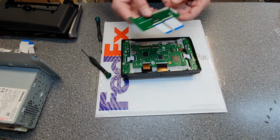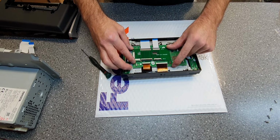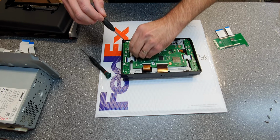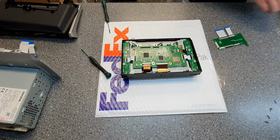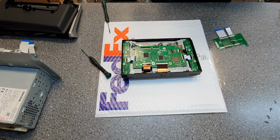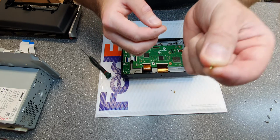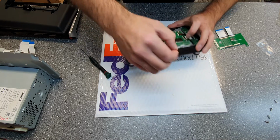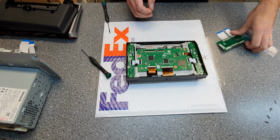Now we're going to install the video board. You can see the 2 screws here. It's going to be like that. Unscrew these 2 screws. These you don't need anymore. And you got 1 plastic bag with 2 new screws, 2 extenders. Take these extenders and screw them in the same holes as the other screws were. And also have something underneath so you don't scratch the screen.